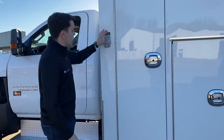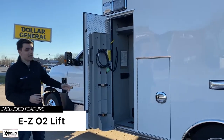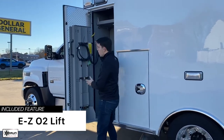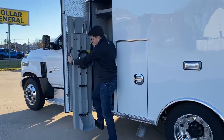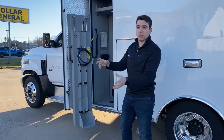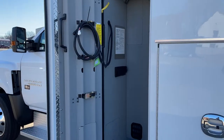Moving down the street side, you've got your shoreline here, and OSS-1 is your standard oxygen compartment with an additional feature that's a Braun exclusive — the EZO2 lift. I'll demonstrate how that is used now. With your oxygen cylinder loaded and out of oxygen, you'll simply drop the EZO2 lift and lock it in place at the lowered position. Then you can unload the old oxygen cylinder and reload the new one. Then it's just as simple as pushing down, pulling up on the lever, and you're ready to go.